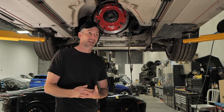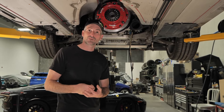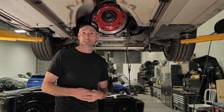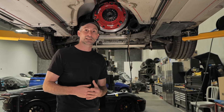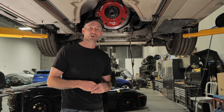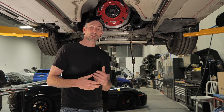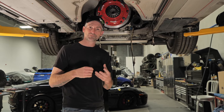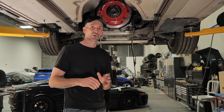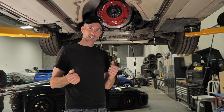As mentioned when we started this series, this car had actually sat for quite a while — probably getting on for two or three years. One of the things that's really not good for seals is when they don't stay lubricated and warm. Sitting for that period of time, the seal got a little bit brittle. It's been cold here and when we fired the thing up we had oil coming out the back of the engine onto the clutch — it didn't hotspot the flywheel at all, but it caused slippage.